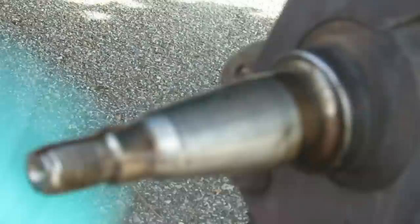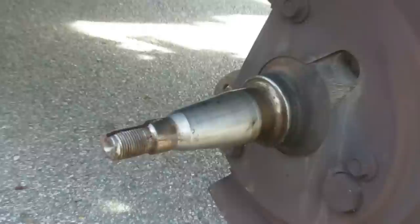While we're waiting for the customer to come back with new bearings, take a rag and clean off the spindles — get that old grease off because we're putting brand new grease on. Clean up where the seal goes on both sides. Get everything ready so when the customer returns we can put the rotors and everything back together.